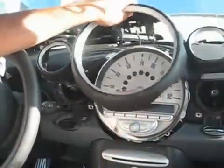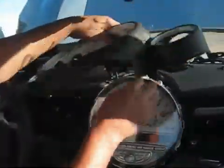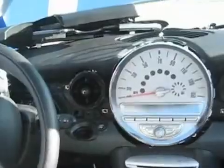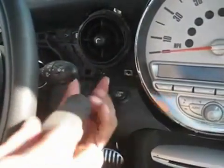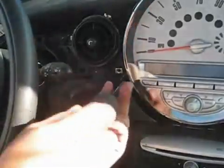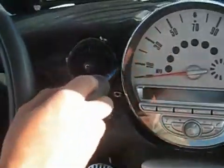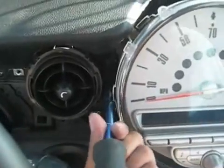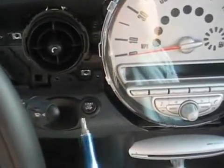What I've done here is just pulled it off — it comes off straight out and up like this. Pull this off so you have access right here, and now you can see more screws that are exposed. Going from left to right, take off these two screws. I said three earlier, but it's really four screws. Go around the odometer. Be sure not to take off any screws you don't need — for example, you'll see two screws here. You don't need the top one, but you do need the bottom one, which holds down the odometer itself. Don't touch that top one or you'll start taking this plastic part off unnecessarily.